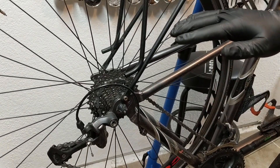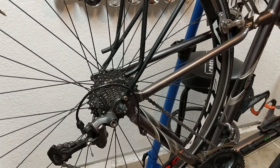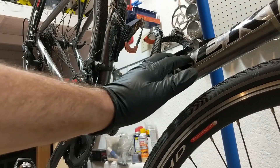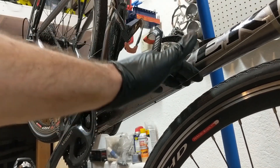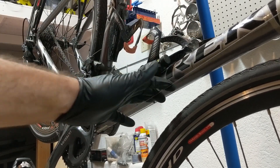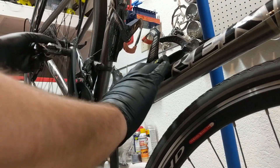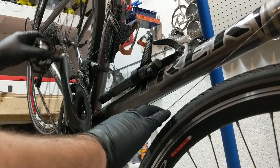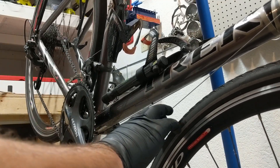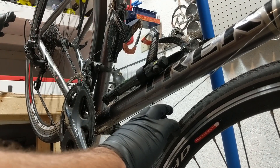The procedure is very simple. Although some of this stuff looks like voodoo when you're shifting, all you're actually doing is adding or removing tension from this cable — in this case for the back. You'll see that as I pedal the bike and pull on this, it jumps up to the top gear. I'm putting good tension on it and that chain is not going too far in that direction because those screws are set properly.